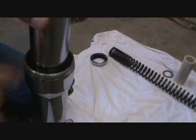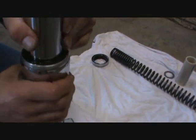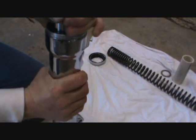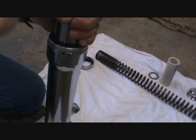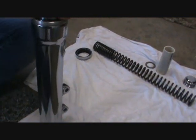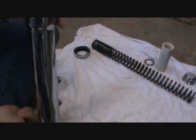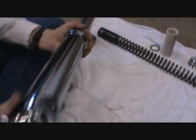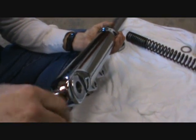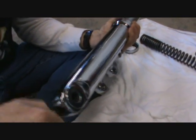Now you've got another seal that's in here. In order to get this seal out, this is where you grab both of them — oops, look at there, it won't come out. I wonder why. Because this is the step that everyone forgets: they forget about the screw that's down here in the bottom. That's the pipe screw — that six millimeter. You just have to take it, loosen it up, and pull it out of there.